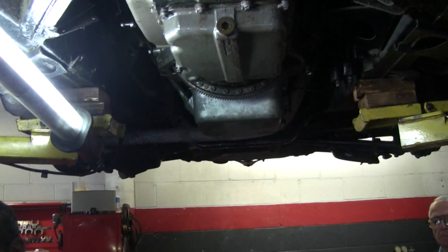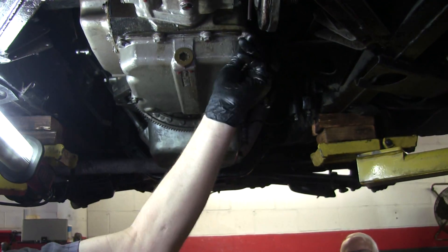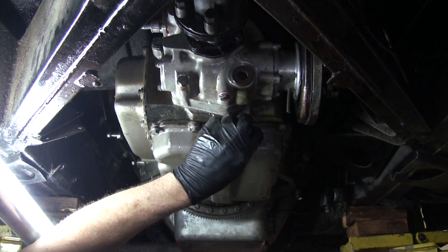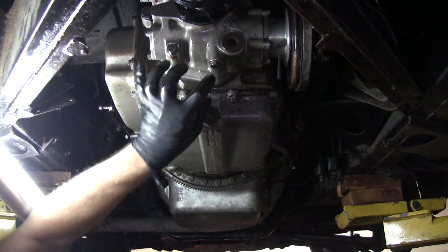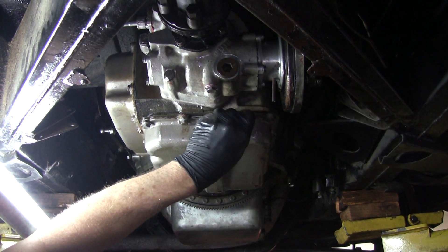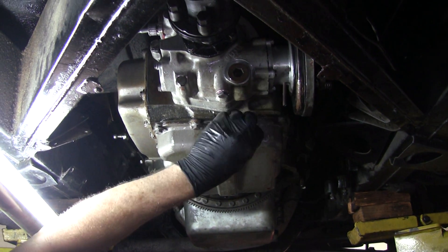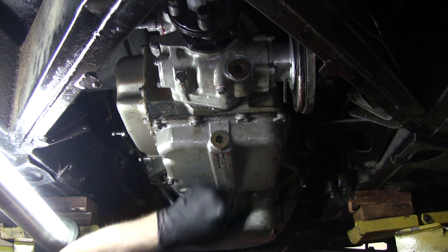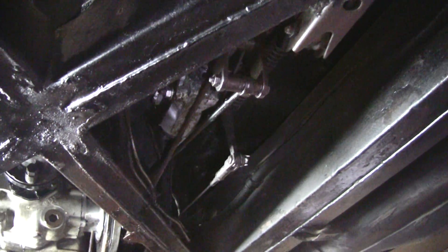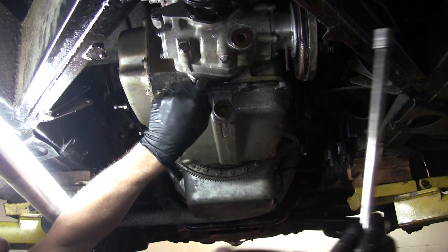The British word for drive shaft is propeller shaft. What's funny is the back part is not called a differential — it's the final drive. On American cars they don't have this big unit that uses this transmission. They do have a housing here because that's where the reverse clutch is. This is the part of the braking system that runs off the transmission — this is your servo. That's a dry clutch in there that is mechanically applied and makes the master cylinders apply. So that earlier discussion about converting — all that stuff has to go away and you have to convert it to total hydraulic, and normally they'll put a booster down here.